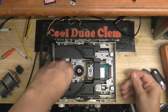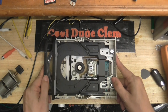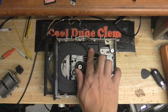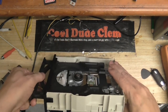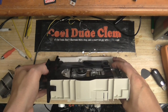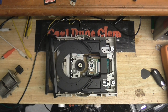Is this little thing sticking up? I don't know if that's part of it, or if that's something that's found its way in there. Yeah, I really think that this is a cam or something that's come out of alignment. If I could pop this tray off — I'll turn this sideways, you might be able to see. When I push this in, the lens and the motor come up. That's not supposed to happen until this is all the way in, so yeah, there's definitely something out of alignment in here.